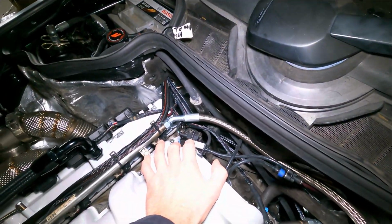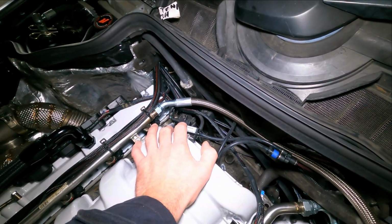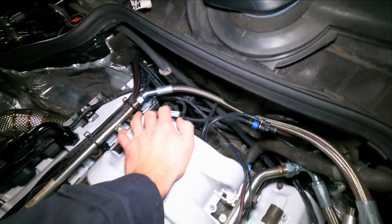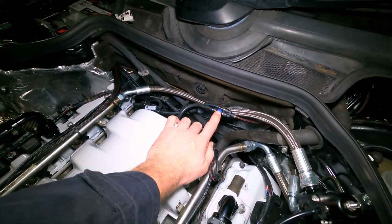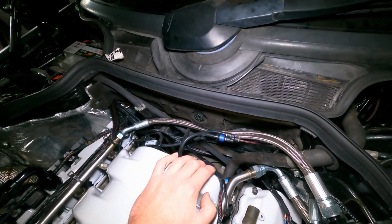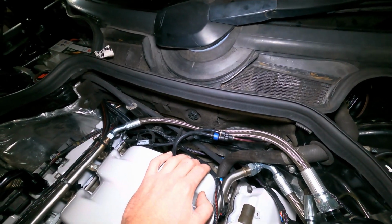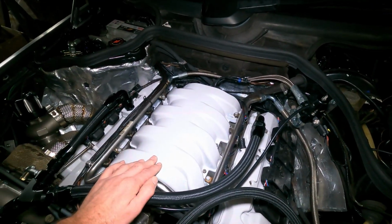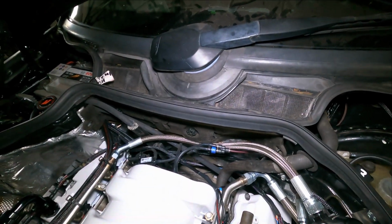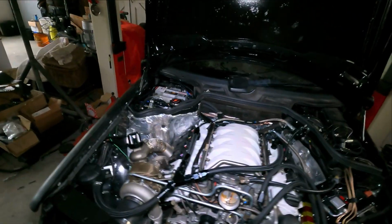I got this, this is the valve for the intake flaps. And of course this is using a vacuum, but in my car you do not always have a vacuum. This is why there is a non-return valve in here, so it will get vacuum that will go in the normal canisters that are also in these cars, the vacuum canister. And if I'm then on the boost, I can still switch the valves in the intake when I'm on the boost, because there is then vacuum left in the canister. I've tested it before installing it.